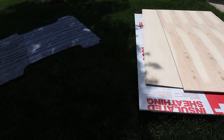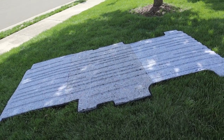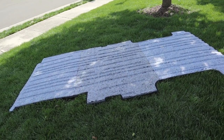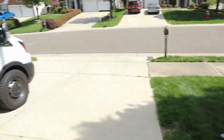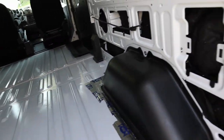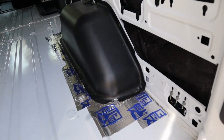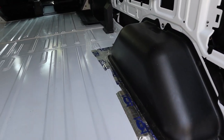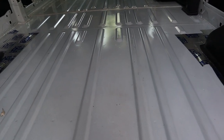Glue that down and then start cutting some templates, maybe even put a plywood floor down. I'm not sure exactly how thick I want to do it yet. But before we do that, first I want to tape around those plastic wheel wells to seal the gap between the sound deadening and the wheel wells. Then I've got to wipe down this floor, and I'm probably going to put some sound deadening in these parts that don't have this rib in them.